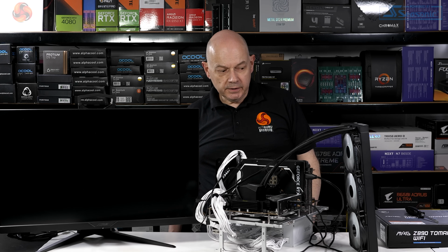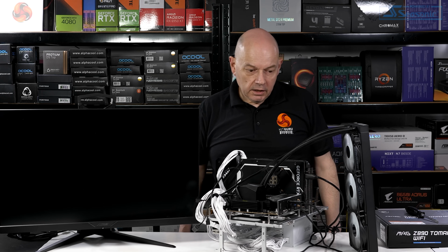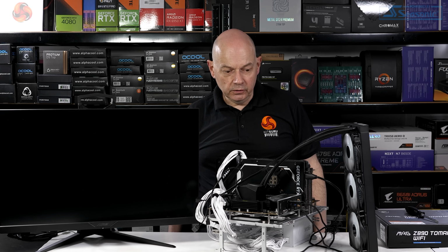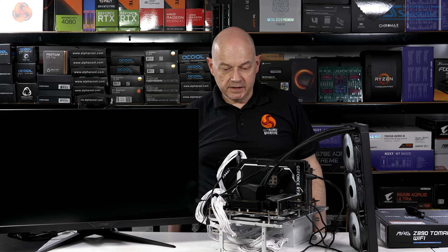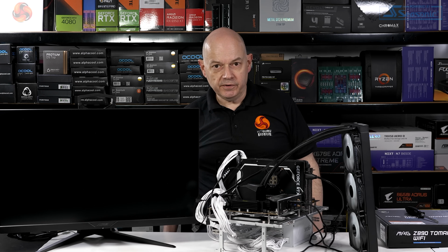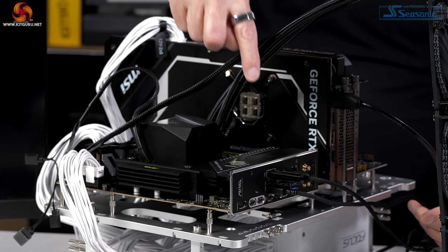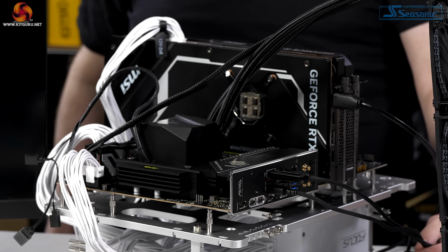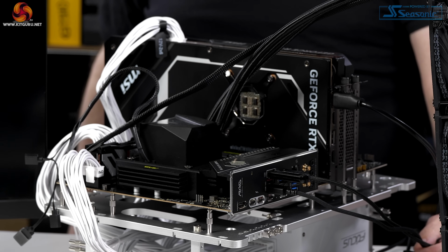We have fan spin, and we wait to see, as the system reads the BIOS file, if it's going to be happy with it. Is it going to update? Is it going to turn this into a functioning PC? Just below the flash drive in that specific port there's an LED. As long as the LED is flashing, the system is continuing to work.